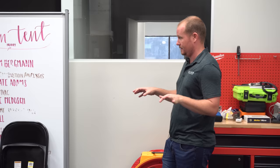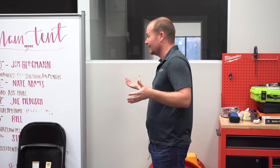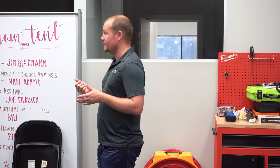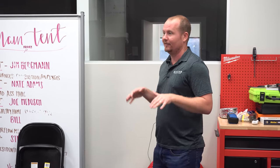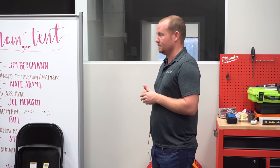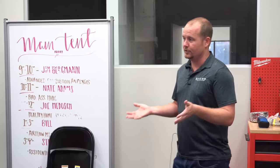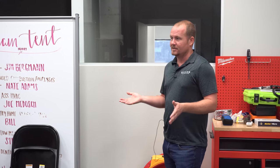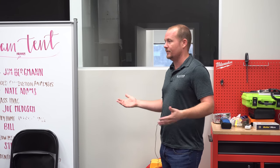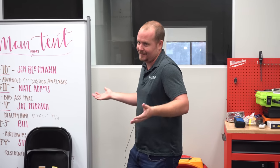It's possible a system could have the wrong wheel on it. Obviously if the blower wheel is running backwards, you're going to move very little air and you'll definitely have an air flow problem. Here at Kalos, people have left blower wheels running backwards — that's an obvious problem. Either we didn't take our readings or we didn't pay attention to the numbers, which are the same thing. Some of us feel good about taking numbers, but if we don't know what they mean, we might as well not be taking them.